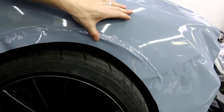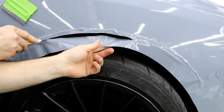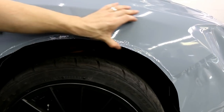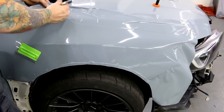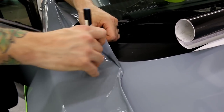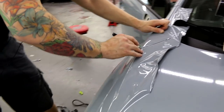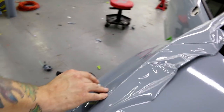As far as this part goes, I'm going to trim it off right on the bottom since I'll have the fender flare sitting there. This customer is obviously never going to remove their fender flares because they've cut the fender off - that's why it has this black coating, basically sealing up the fender so it doesn't rust. Now up here I'm going to start my cut on the inside, about an inch or so in. I'm going to come all the way back to the front with the back of the blade on the opposite panel. I've checked the Subaru fender on the inside and I'll have enough coverage.